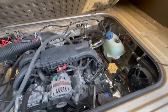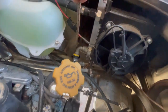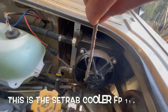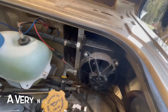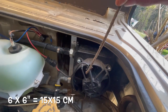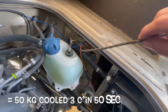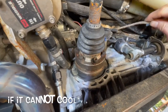Here we are in the engine compartment. The oil comes up from that filter and into this cooler where it goes back and forth through here. This cooler is about six inches by six inches, it has a fan, and it's plenty big to cool a Vanagon gearbox. The oil goes on out — you can see it going down that way — and here's the oil coming from the cooler.